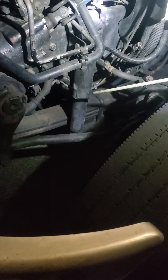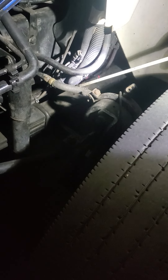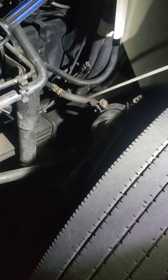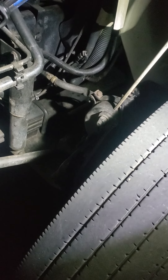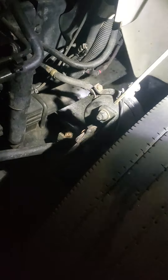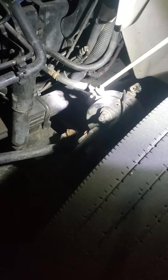I will now check my brakes. Brake system — ABS line is securely mounted at both ends, no split or cut and no exposed wires. Brake hose is securely mounted to the fitting at both ends, no split, cut or fraying. I don't hear leaks. Brake chamber is secure, no crack, broken or dented, and I don't hear leaks. C-clamp is present and tight, no crack or broken, not loose or missing bolts and nuts.